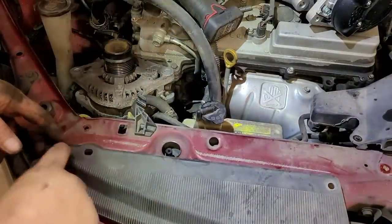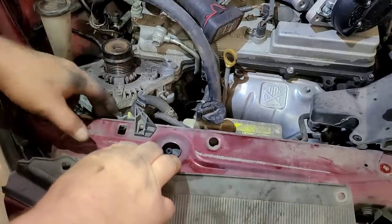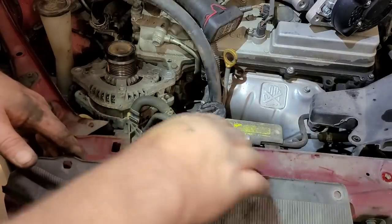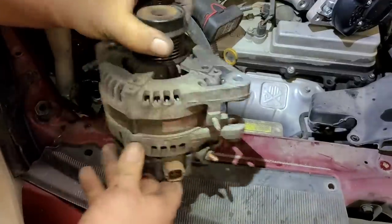All right. Really all I did was take the clips out of the top here. There's a screw down here, a screw up here, same thing on the other side. I took them out so this whole upper support can move. I didn't want to take the hood latch and all that other stuff out. But with that out of the way, I could move the radiator forward. And there — it's out.